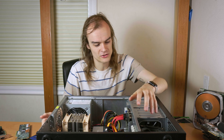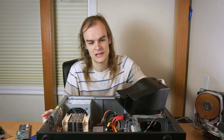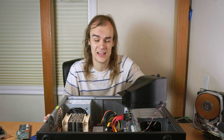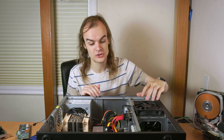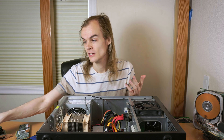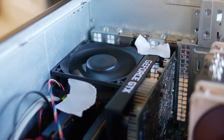One thing I noticed working with this case is the airflow is quite poor. Not having a side panel definitely hurts, and it also just doesn't seem to be laid out that well. There's no dedicated cooling for the hard drives and there's nowhere near enough case airflow to keep them cool. There's something to help cool the PCI slots and chipset, but it has to go through three layers of relatively restrictive grills, so it's pumping out more noise than air. My solution is to just tape a few fans in place - one little fan to keep the drives a bit cooler, and a 120mm fan over the PCIe cards to keep those SSDs and network cards cool.